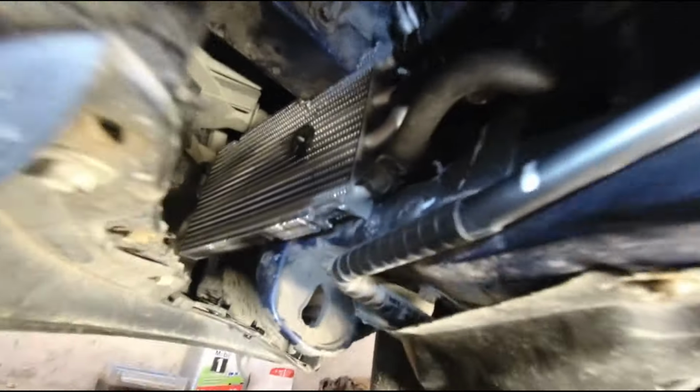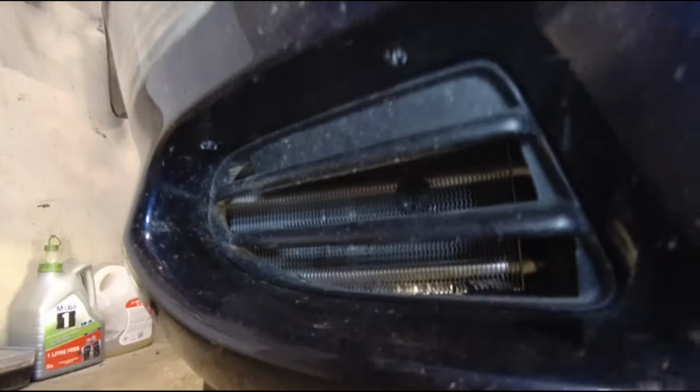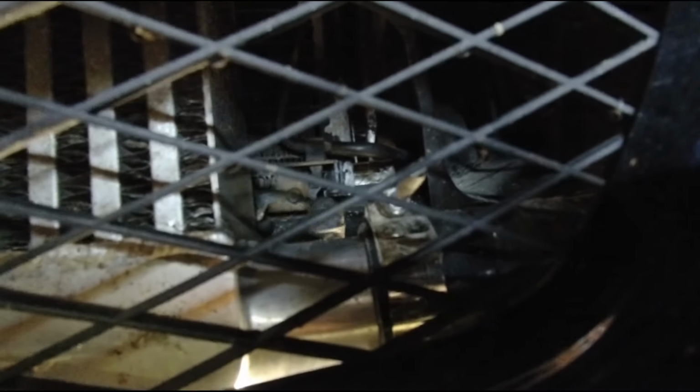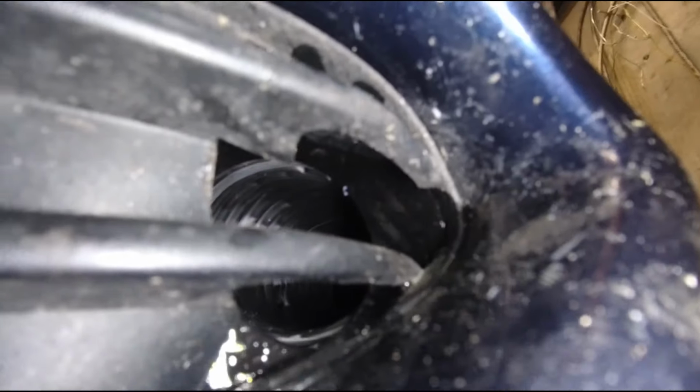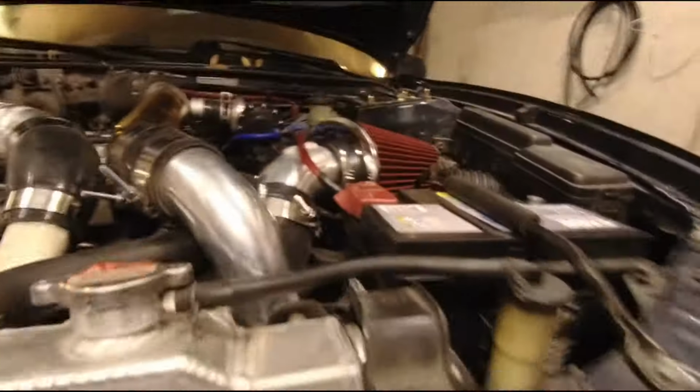Yeah, so the steering radiator is now really nicely getting air. Intercooler, I think, cannot be lower. You might think I'll put it lower, but the thing is that behind here is anyways a bar. So if I put it lower, then the intercooler is blocked from the other side. It is very nicely even. From here you can also see that it feeds right into this tube. And the tube goes all the way up here.